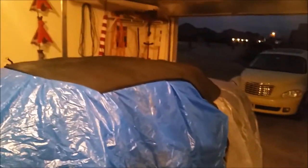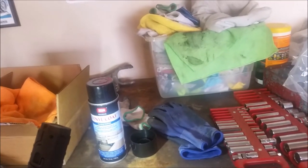I just got done with the first can of the SEM vinyl coat, called Flexible Coating, part number M25053, Ranger Black. First coat is on and it took the whole can for the top. As you can see, so far I'm pretty impressed. I'm gonna wait about 10 minutes between coats — the can says 10 minutes — and then I'll come back and do the second can. Good thing I got two cans.